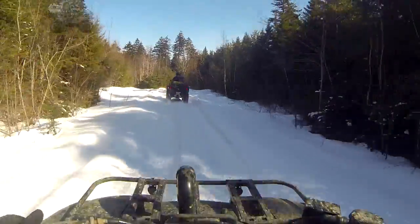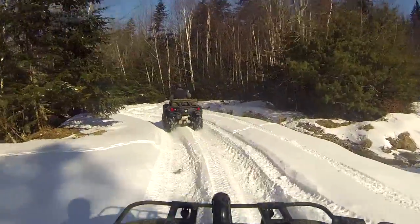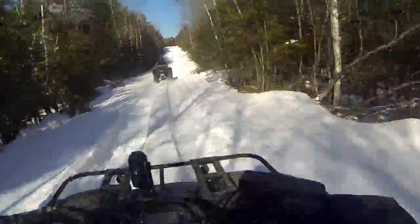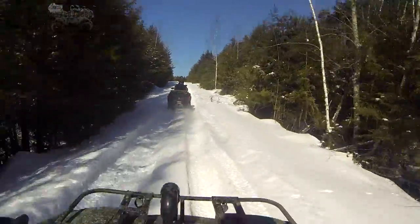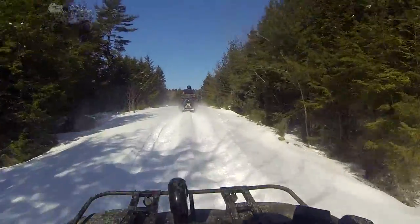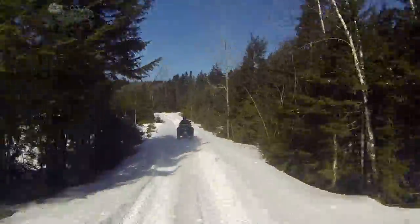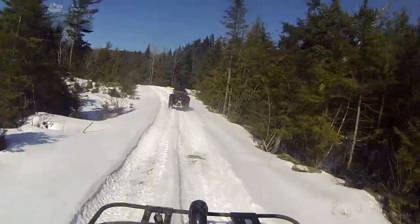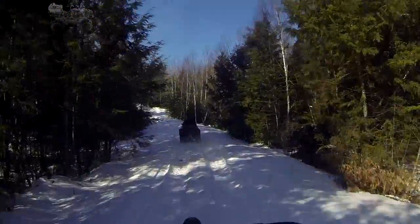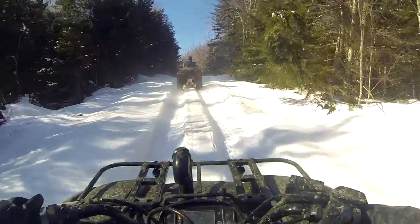I'll be hard-pressed to get to the end of next summer, or this upcoming summer, out of these tires. Like I said before, it's not a matter of the wear. They're wearing well, but when I bought these tires, especially the rear ones, they were on a really, really good sale, and I know why now, because they're weather checked on the side. I didn't know how long they'd been sitting on the shelf when I bought them, but that's a good thing to ask, actually. Next time you guys are after a new set of tires, you're at the dealership, and they got them on sale, you ask them exactly how long they've had them in the shop and how long they have been around. I think they're the same as any other tire where they have a manufacturer date to them, but I'm not quite sure. It's a good thing to do a little bit of research on something like that.